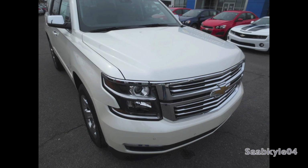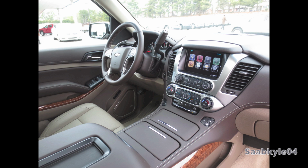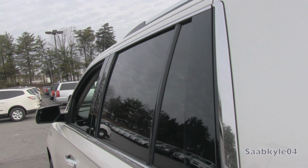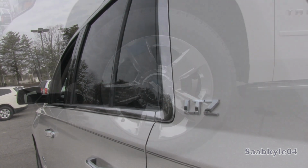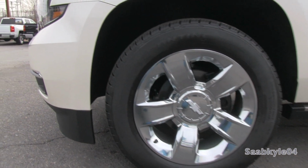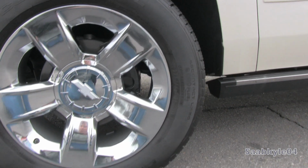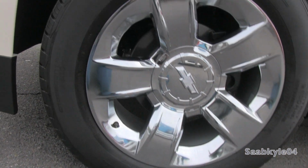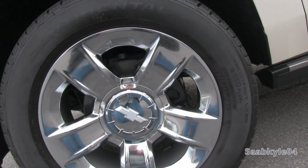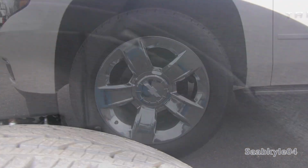Other designs were also adapted from the new Silverado to help further quieten the ride, including triple door sealing and embedding the doors in the side of the body rather than wrapping them over the top of the frame. The LTZ Tahoes come standard with an upgraded set of 20-inch polished aluminum alloy wheels wrapped in all-season tires, 275/55s at each corner. Aiding the improved interior isolation, new felt liners also wrap all of the wheel wells like they do in the Silverado, helping absorb excess road noise.